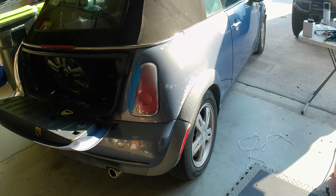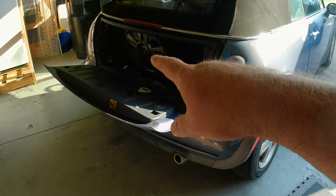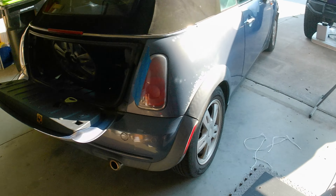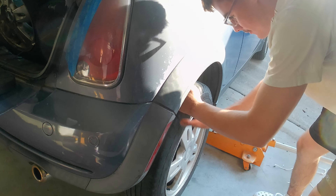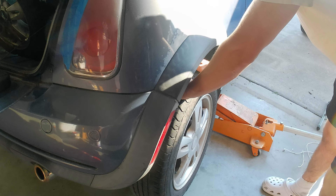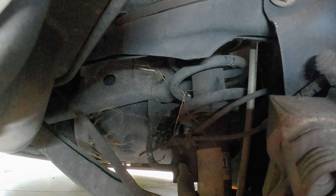That's the cheapest Mini Cooper. We'll do a quick shakedown of these wheels, pull it apart and see if we can fix things. We'll get this jacked up - go ahead and spin it. I think that might be a little bit of wheel bearing but we need to take the wheel off and take the brake off to make sure. I had Colin push the wheel up and down - and that would be the top of the strut. The strut mount is shot.